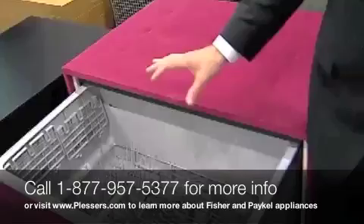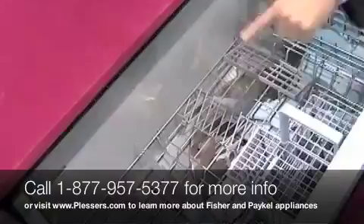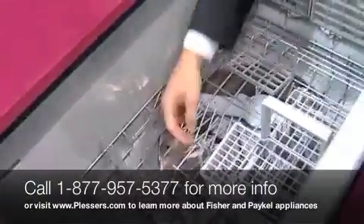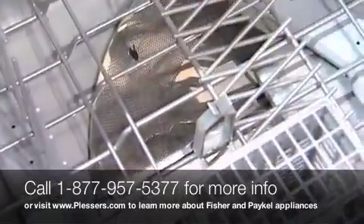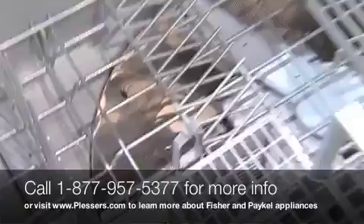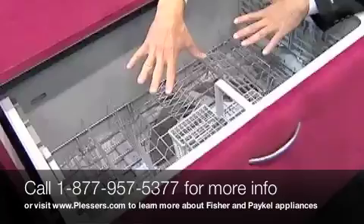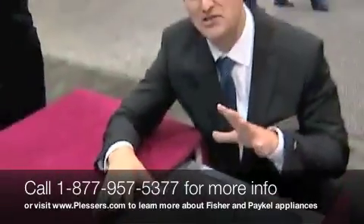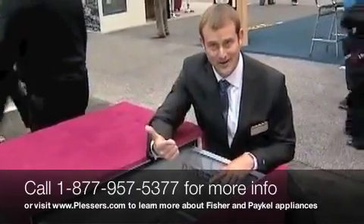Third and final, this has a very unique drying system and you don't see a heating element like in most dishwashers. The heating element is located underneath this stainless steel pan. We rinse at 165 degrees, then trap that heat into this area and turn a fan on — so it's a more efficient and quicker way to dry.